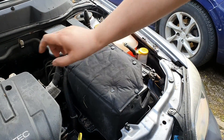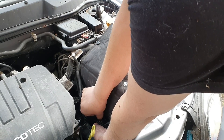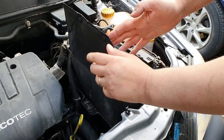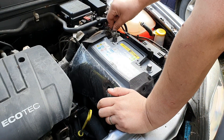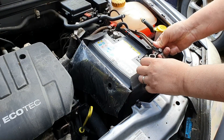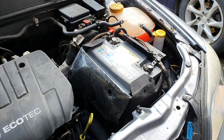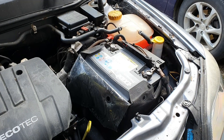When you put your battery in and tighten down your battery clamp, don't forget to put the clamp on before you connect any of the battery terminals. You want to first start off with positive, which is this side, and then the negative, which is that side. Tighten up with a 10 millimetre socket or spanner.